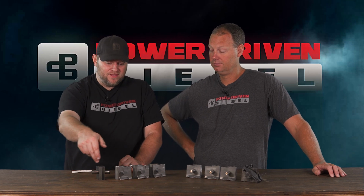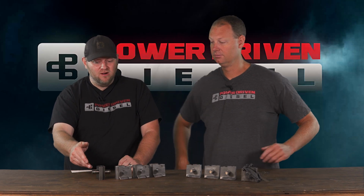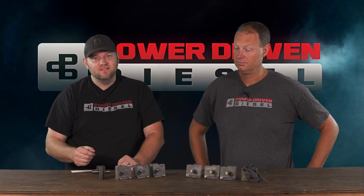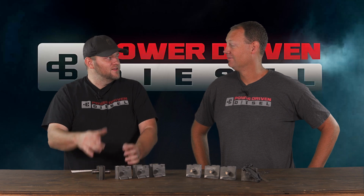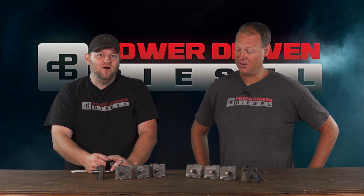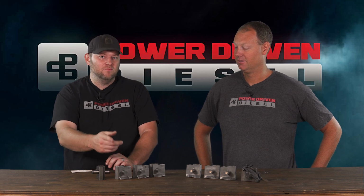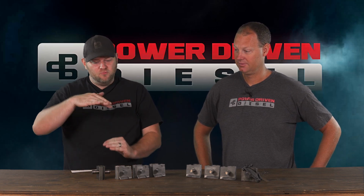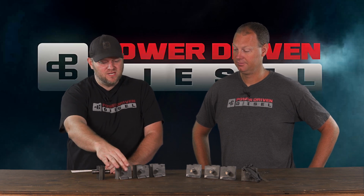The final thing is these factory pins are pretty hard, and even then, they can still gall. So when we made these upgraded pins, they're hard as a coffin nail, is the figure of speech. They're very hard. They had to be surface ground. They're so hard you can't even machine them. So they are a stiffer pin to help with that flex. The other thing is the press fit is a little tighter.